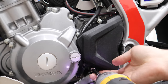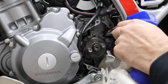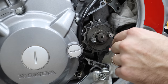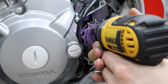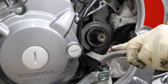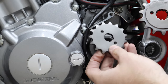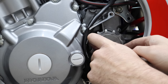Pop off the front sprocket cover — it's two 8mm bolts. Blast some WD-40 in there and let it work. This setup uses two bolts and a locking tab, which is nice because you don't have to worry about stripping a giant nut on the shaft inside the engine. Through the magic of the camera, it's all clean. This is our 15-tooth sprocket from the package — it looks a little weird though. I think this is a ground 15-tooth. In the morning I'll call around; if I can't find a 15-tooth, we'll just run the 14-tooth.